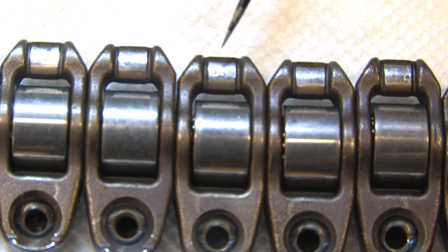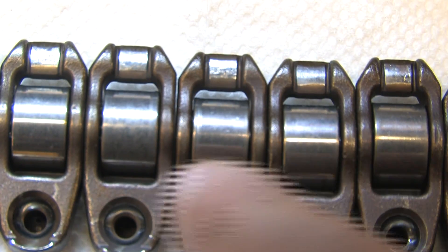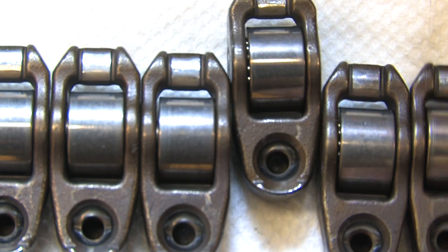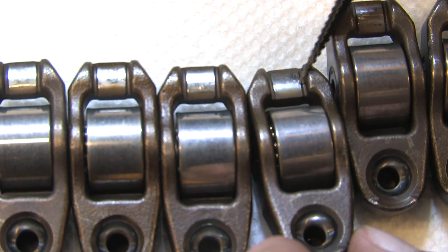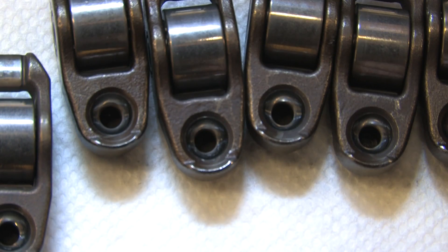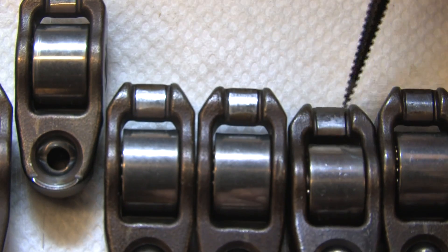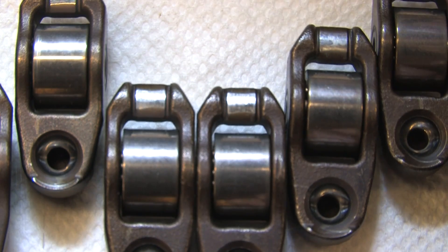But this isn't good — this isn't pitting, this one is completely shot. The valve surface is chewed up, and that means it's either my fault from over-revving and causing valve float, or the springs I'm using are too tight or binding. It's not the only one either. This kind of stinks because they're 18 bucks a piece. Going down the line, several of them are chewed up or cracked. While this kind of damage can occur from oil starvation, it can also happen from incorrect valve geometry. I'll be scrutinizing the valve install height and spring rates before putting this one back in service. While that's part of the blueprint process, measuring it accurately requires tools that are too cost-prohibitive for my project — I'll rely on a machine shop for that help.